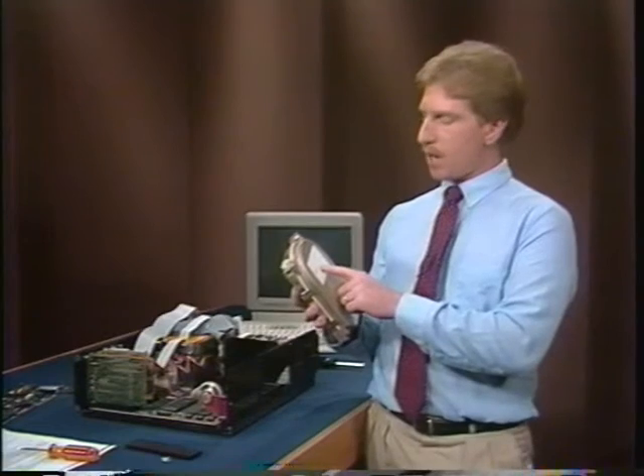We're ready for the hard drive. If you don't find an error map with the printed material, there's probably a label attached to your hard drive. Copy the information down. You'll need it when we do the software installation and you won't be able to read it when the cover's been reinstalled on your PC. I'll explain the error map when we get to the software section.